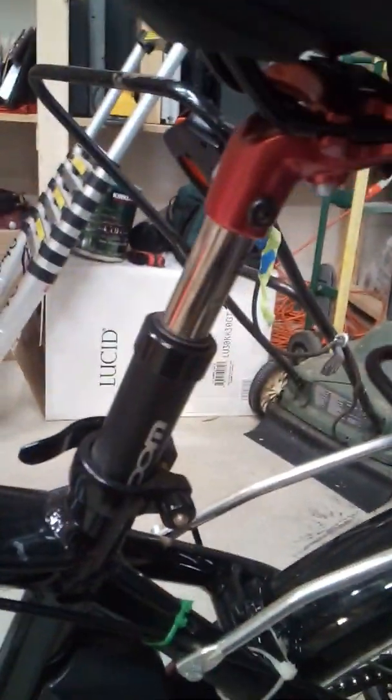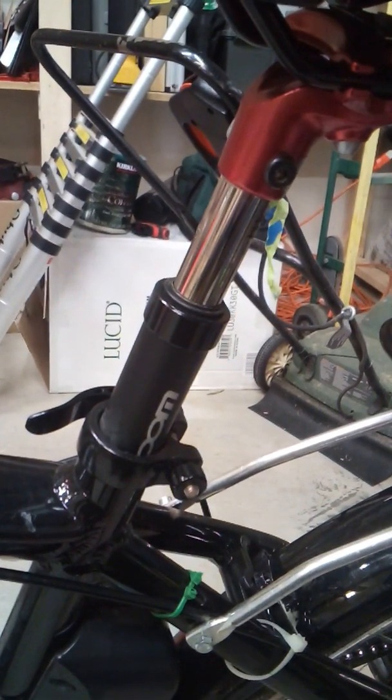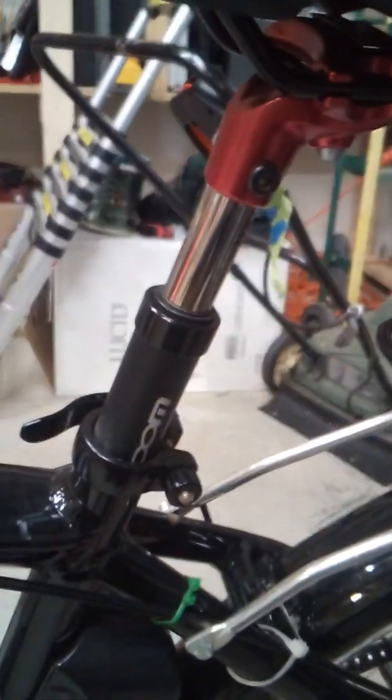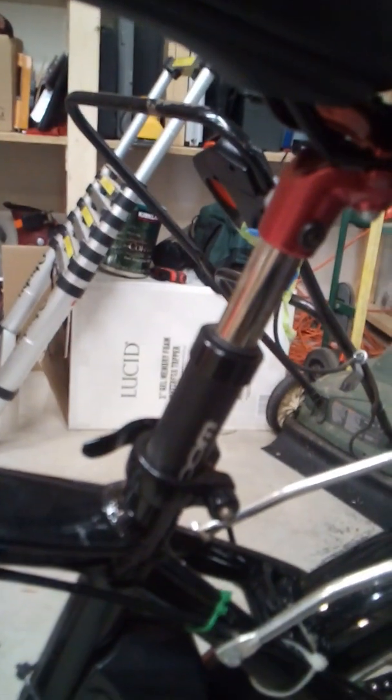Is it about the size I used? You know, something to go in there. Decent size. Worked pretty good. That's Allen head on this side. And I just find the exact size drill bit that was a little bit smaller. What you want to do is make sure that the drill bit you're going to use is just a hair smaller than your actual bolt.